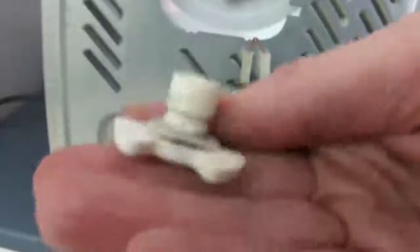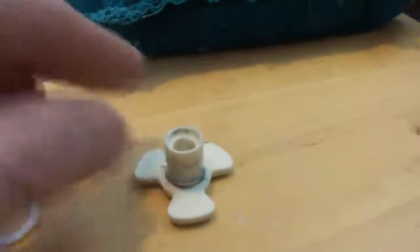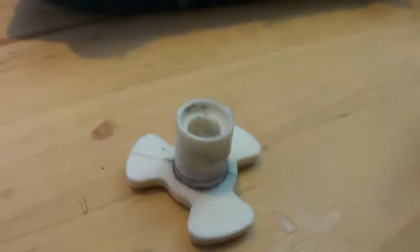Once you've removed the motor you can jiggle the turntable coupling out into the microwave chamber. The coupling has a flat on it which is supposed to engage with the motor spindle, but the flat gets worn away so that the spindle just turns freely inside. I'm going to rebuild that flat.